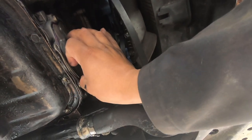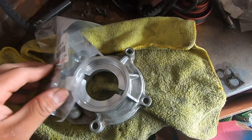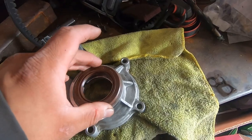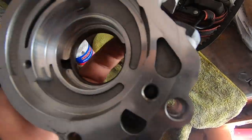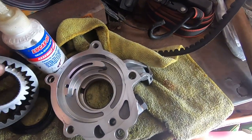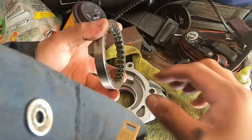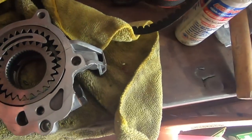It kind of sucks doing it upside down on the car because there's not a lot of space. We're going to start off by installing the T-type oil seal for the front of the oil pump. All we're going to do is put a little bit of that grease on the edge as well so we can drive this all the way in without an issue — make sure it's completely flat when you're tapping it in. Now that we have the seal all the way in and checked a couple of spots to make sure it's seating all the way, we're going to install the gear. We're going to lube them up — put oil in here all the way down, put this one in place and then the smaller one in after. We're going to use some of this Lucas assembly lube.